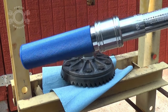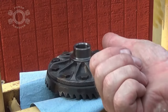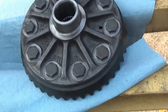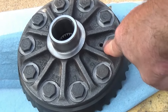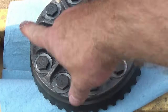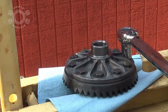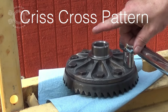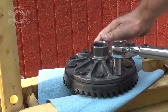Take your impact and run the bolts down to the touch, then take your torque wrench and do 25 pounds all the way around, then 50. To help yourself remember where you started and stopped, use the roll pin knockout hole as your starting reference — go all the way around, so you can keep track of where you're at. I've already done the 25 lb pass; now we're doing the 50 lb pass.